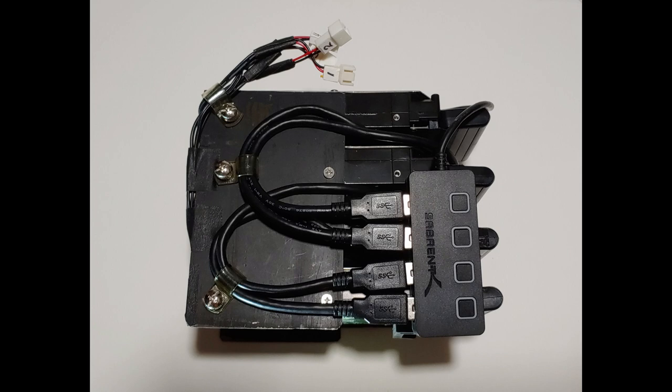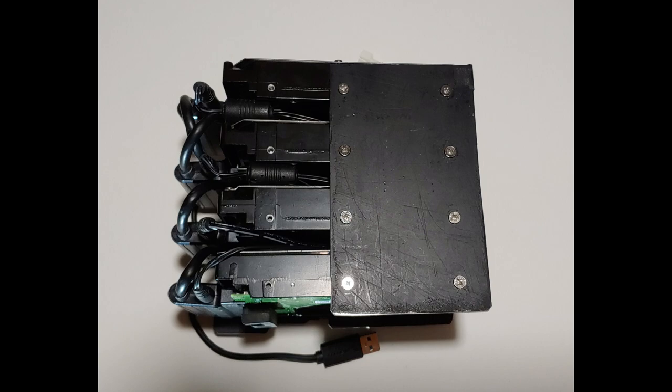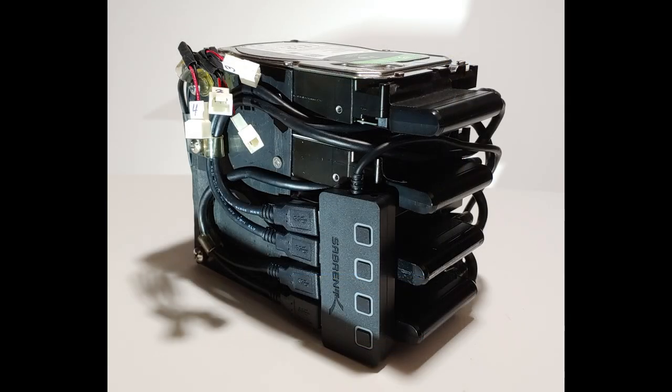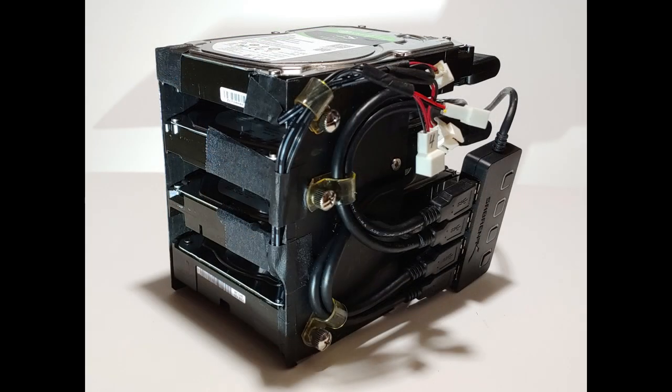And now the real heart of the project — the stacking of the drives. I've included several shots here from different angles so you can see the detail. The drives are stacked with about half an inch of space between each one. I reused the metal from the screen cutouts and drilled mounting holes as side brackets. The SATA adapters are mounted on the front of the drives, their wires routed around the external part of the drive, then plugged into the four-port USB hub. The power cords for each drive and the hub feed back through the gaps and are taped to the drives and brackets to reduce air interference. They have quick connect connectors so the drive can be modified or removed from the box.